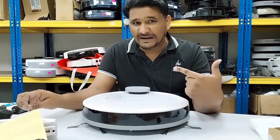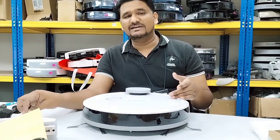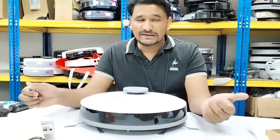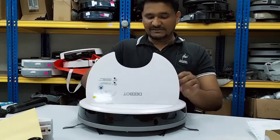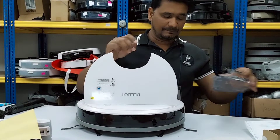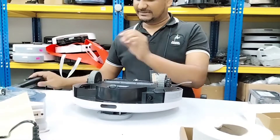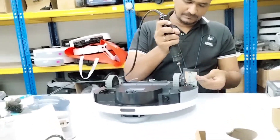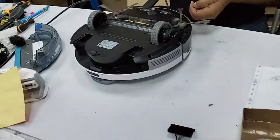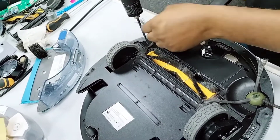The LDS is not turning, so it means that the LDS belt is broken. That is why just the motor is turning and making the sound. Now we will open it and see what's inside. I am 100% confident that just the LDS belt is broken — that is why we get this sharp sound.